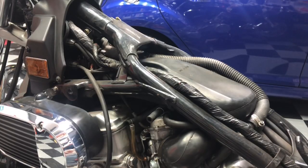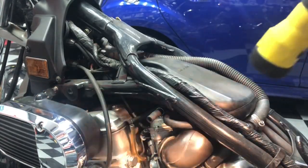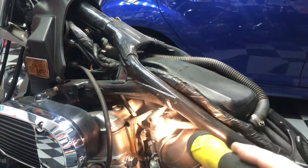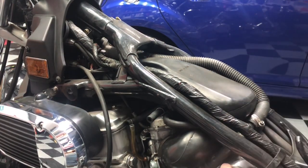Let's start at the top and work our way down. The air comes in through the air filters on either side, and on the right side of the bike goes through the plenum. Here's the airbox, and then the air gets distributed to both the carburetors on either side. This hose here carries coolant to the rear cylinder.